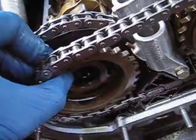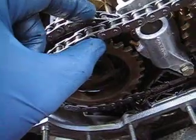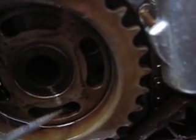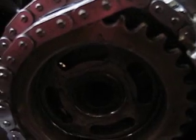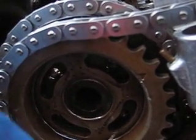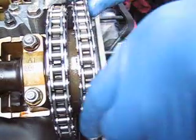Making sure there are no kinks in the chain, go ahead and slide the secondary exhaust sprocket onto the hub. Roughly, I've lined up this arrow with the one behind it, just for reference. Looking down, you can see one hole roughly at the end of each slot. Go ahead and move the chain left and right to see how these line up. With one full motion, they're nowhere near the ends of the slots where they should be, so much like the primary sprocket, we're going to have to make slight adjustments to get it into the correct position.